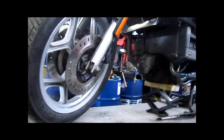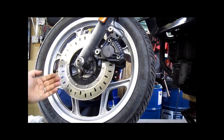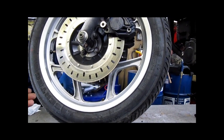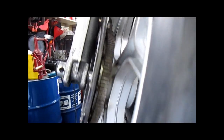I would like to point out one abnormal issue with the K75 with ABS with Y-spoked wheels. You'll notice the lettering is on the left of this rim, completely opposite of the rear. Now, normally, the stampings on a BMW wheel are always on the right side of the motorcycle. So you would look at this and say, hey, some boob put the rim on backwards, even though the tire is on the right direction. That's not the case with this. There was this model, and there's another that had this issue with the rim being around the other way. But anyway, this is assembled correctly.